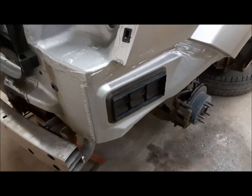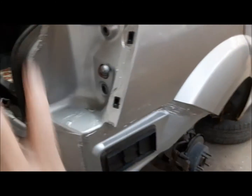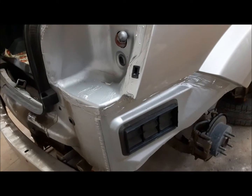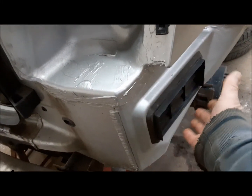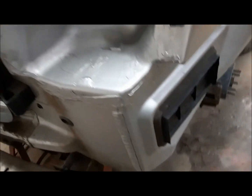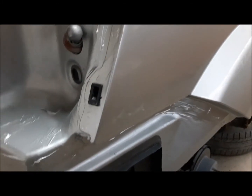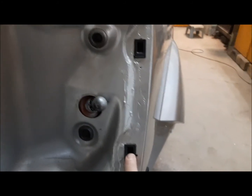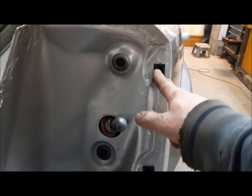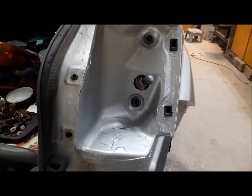Yeah, it's pretty much dry. So now I'm not going to roughly handle the quarter panels or anything, but I could start working in the periphery here, getting some stuff put back on. So I've put our exhausters in. Those are for when you shut the door, these new cars are sealed up so good, these things let that cushion of air out. I've gone and put the locators for the taillights in. Now I guess I can install the taillights themselves.